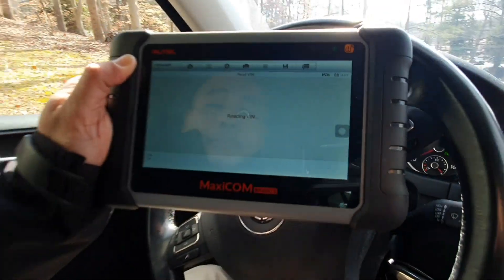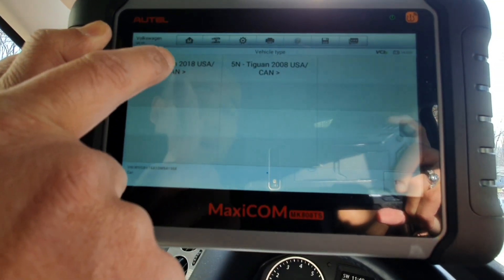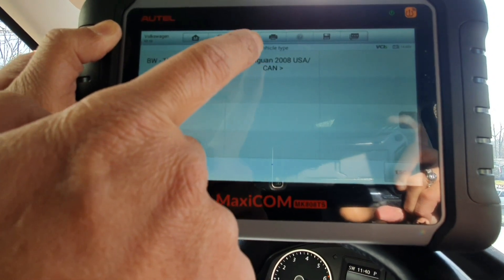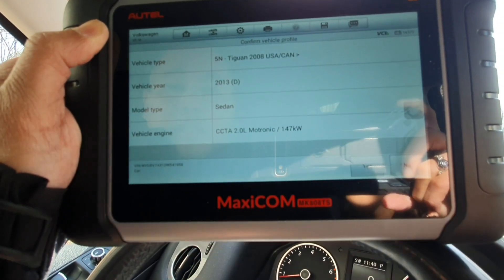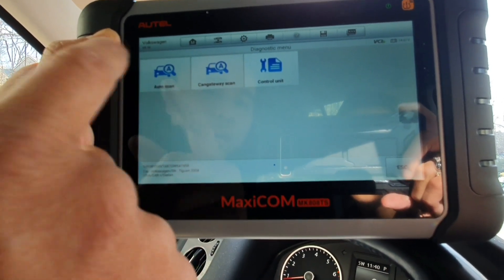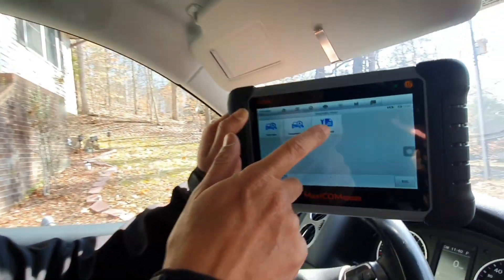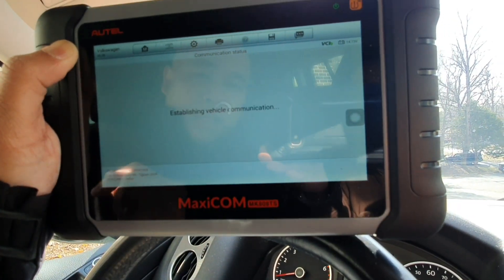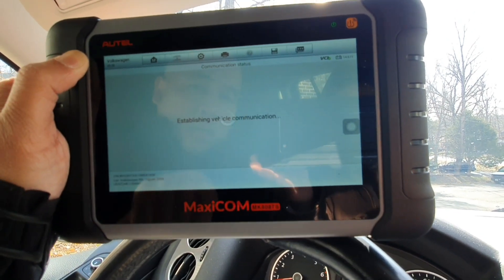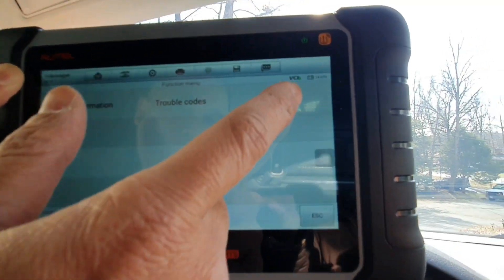I just click Read, and now I can click OK. Now, if you have a 2018 or newer Tiguan, you click here. Since I have a 2013, I'm just going to click here. It's so cool! Click OK. Since I just want to pinpoint the transmission ATF fluid, I'm going to go to Control Unit — Transmission Control Module. Isn't that cool? I'm going to click on it. Establishing connection to the transmission module. Since you only want to see the live data, you want to go to Live Data.